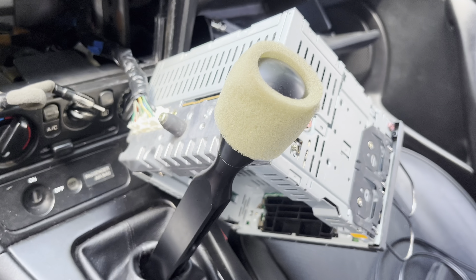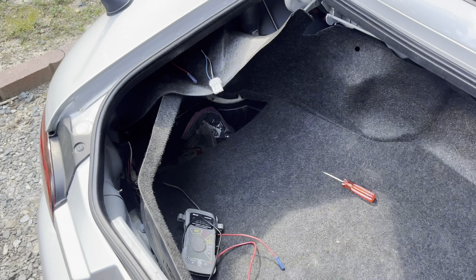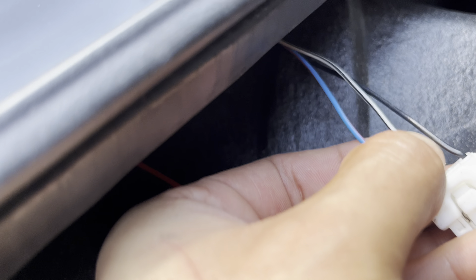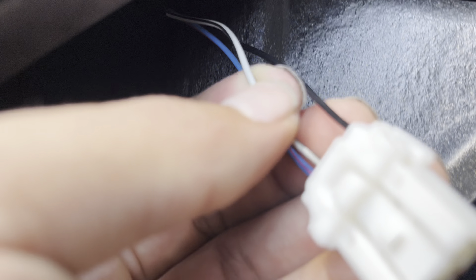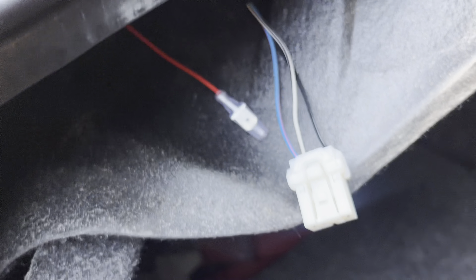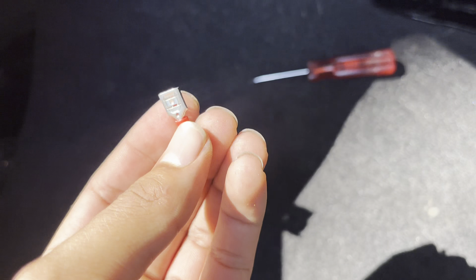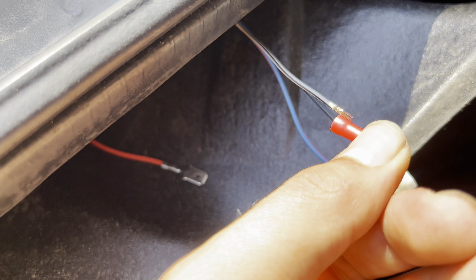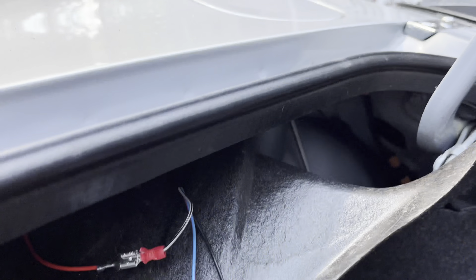That's kind of upsetting — we have to go back and screw with the stock wiring. So let's go to the trunk. I traced the wire that has power when the radio's on — this black and gray one. This one's a constant, this one's a ground. I'm gonna cut it back here so I have enough to plug in. I actually found an end that'll fit the Moss Miata connector perfectly — exposed the wire, put it in there, and crimped it. We should be good to go.